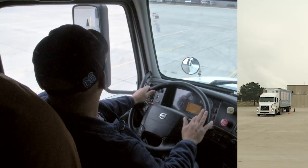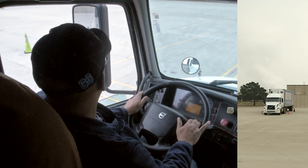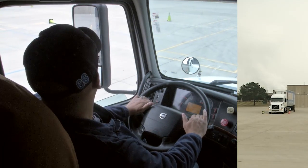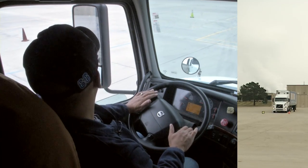And vice versa — if the back of the trailer goes to the right, I turn the wheel to the right, about a half turn, hold five seconds, and then back center with the wheel. As you're seeing here with my wheel movement, there's not a lot of spinning or turning of the wheel. Simply letting the equipment do most of the work for me.